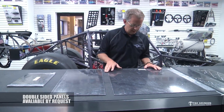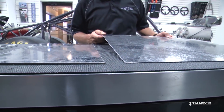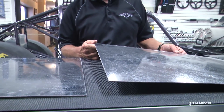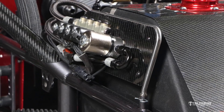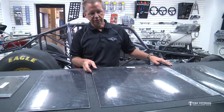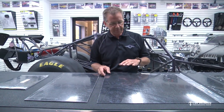Stepping down from that, this is a piece of 088 or 090 depending on what run it is. This is a good panel for mounting accessories that maybe wouldn't be as heavy as some of the ignition components or controllers. This panel is a little thinner than the eighth inch, but it's still got plenty of rigidity to it, especially if you mount it with some quarter-turn fastener tabs — or a lot of times we'll just use a small weld-on tab and put a 10-32 machine screw through it to hold it onto the chassis. You can do the same double-finish trick with this thinner panel.